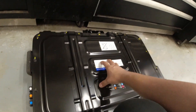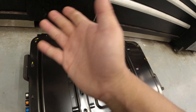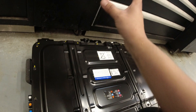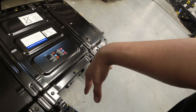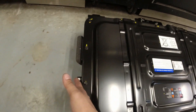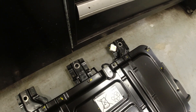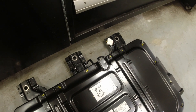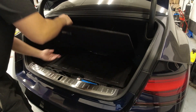I opened this one because there's also a fuse inside — I may show that or maybe not. We're going to do a straightforward replacement. There are bolts here — one, two, three, four, five — we just have to remove this connection here and this connection there. So let's go to the trunk and remove this 48 volt battery.